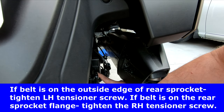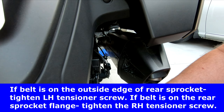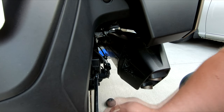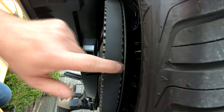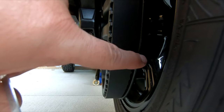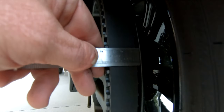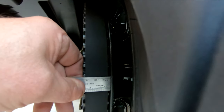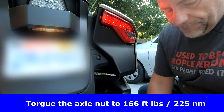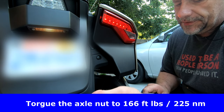I'm looking at the back pulley — I'm going to adjust by turning the screw a quarter turn only. I just checked it and it still needs a little more, so I'll turn it another quarter turn. I'm eyeballing it but that looks good — a little more space between the edge there. The rear sprocket flange and the belt should be no more than 3/16th of an inch — it's right within limits, right on the 3/16th. That is beautiful. Once you think you're done, go ahead and torque this down to 166 foot-pounds.